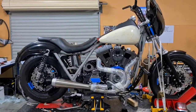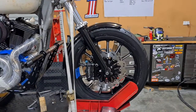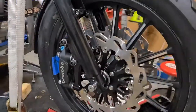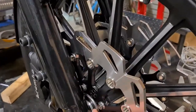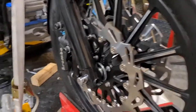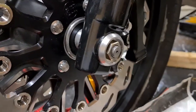I'll run through the bike as it stands. Starting with the front end, we've got the DX forks bolted up, 13-spoke late-model sealed bearing mags. I ended up putting the three-quarter inch sealed bearings in — they sit a little bit wider. I wanted to run those fatter bearings for more surface area. That required me to make new spacers. Since the last update I've got a tiny little lathe over there, so I can start making bits and pieces — got a spacer there, got a spacer there.